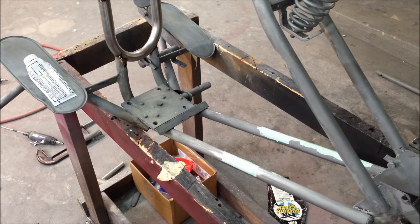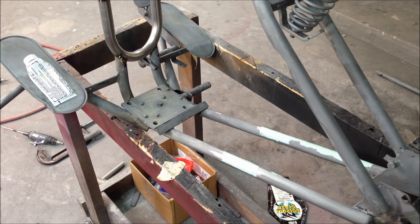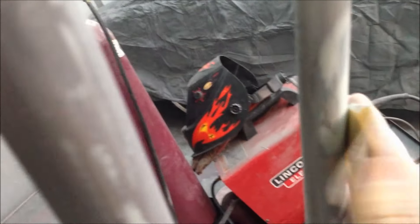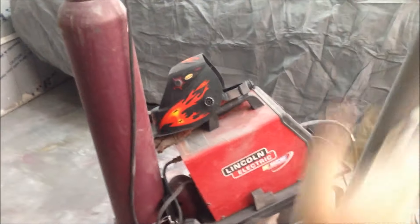All right, well that'll do it. Hopefully we can get all that sanded in one sanding. Over there on that frame, the reason I put all that up there is there was a kind of a bad spot, and on this side there was a spot where it looked like a wheel had ground into the side of the frame. Just trying to touch up a couple of little spots like that. Running over it real quick with some 240 grit after hitting it with the DA with 120.